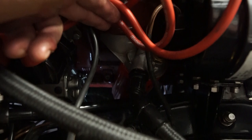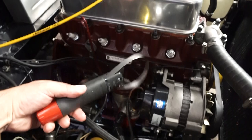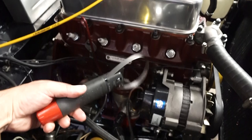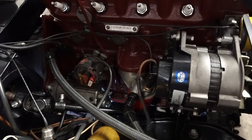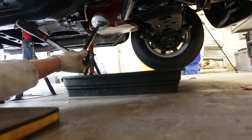Now that the oil is draining we can turn our attention to the oil filter. In this car I have an upside-down filter that sits possibly a bit lower than it will in your car. Just to make access a little bit easier I'm going to take the distributor cap off and the HT lead. In order to remove the oil filter you may find something like this oil filter strap wrench is very useful. As I only use the same type of oil filter each time, I've got a socket that I can put on mine from the bottom to get it undone.